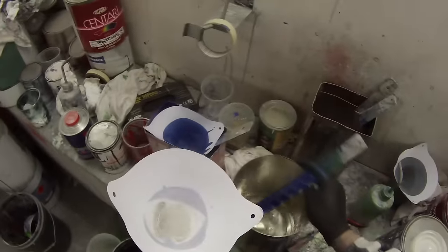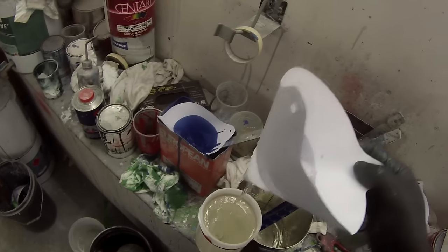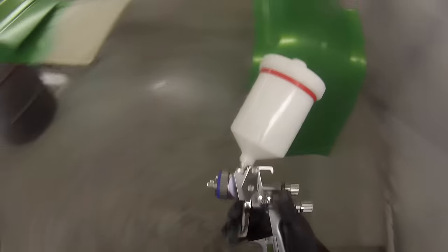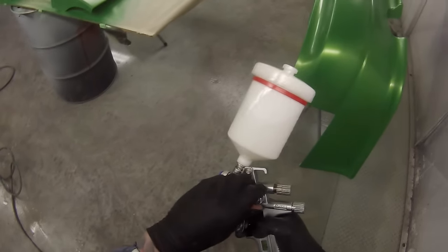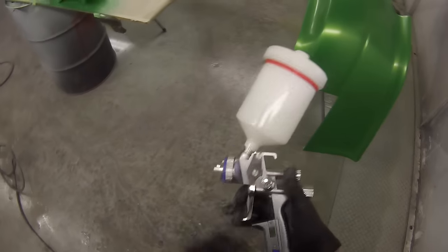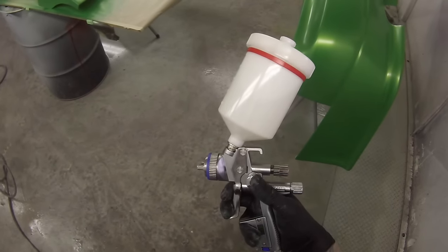The worst part of painting in the cold is the paint doesn't dry quick enough, so it stays wet longer and raises the risk of running. There are actually a few other added advantages to using preheated clear. Because this job used 200-micron holographic flakes, we wanted to bury those flakes with the clear coat. We used a high-solid clear, which is quite thick — medium solids are a lot thinner.